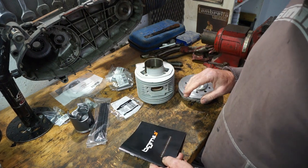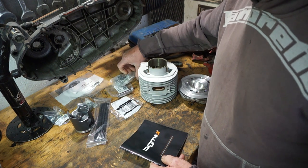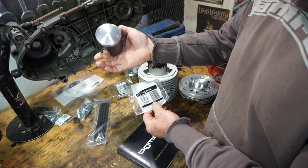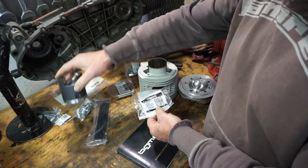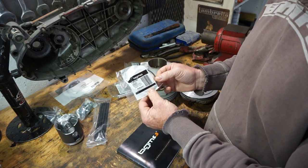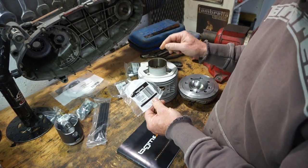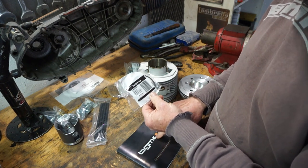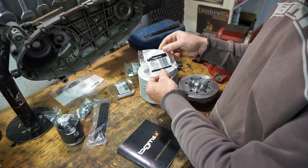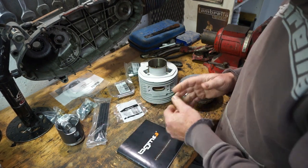Here's basically the kit, what we've got here: cylinder head, cylinder, gudgeon pin, head bolts, piston rings. Now, noting that a piston is matched to the barrel — it's an A, which is the smallest one. The piston rings only come marked 65mm, so it means it's the same piston rings for every size. Therefore it's really important to check the ring gap on these, and it gives you information in this booklet on how to do that. Especially with the A piston, which is the smallest — that means there's a very good chance that the ring gap will be tight. So we're going to have a look at doing the ring gap.